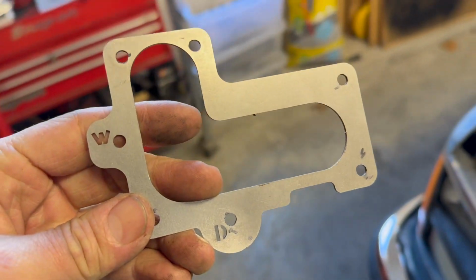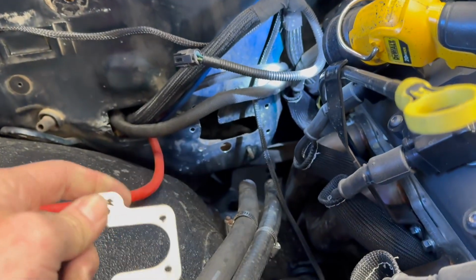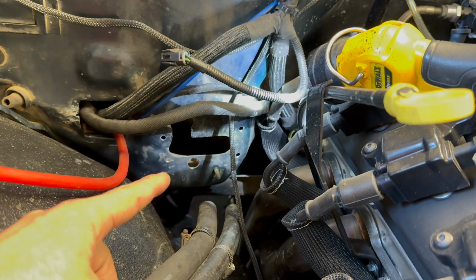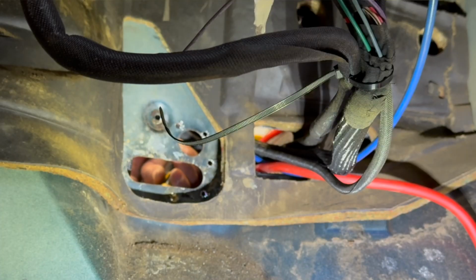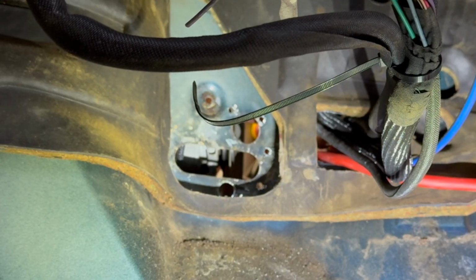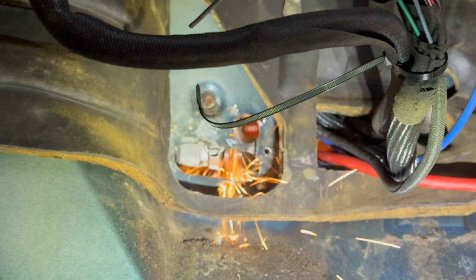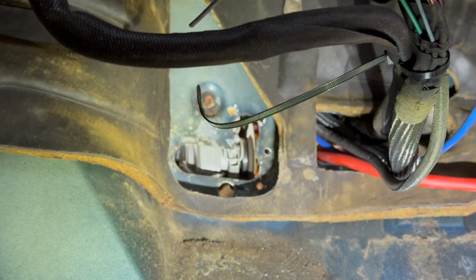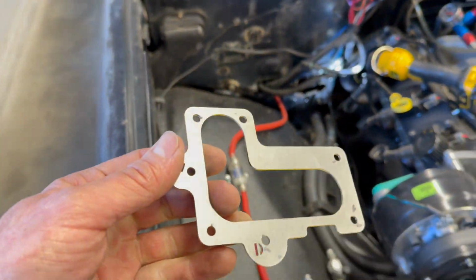This little bare metal piece that they shipped is actually a template that you lay over where the factory lines came through the firewall here, and you drill those out where the holes are marked, and then you have to drill a little larger hole in the bottom. That's for the condensation drain, and then cut, it says 3/4 of an inch of that little metal strap that's left between the upper hose and the oblong oval. So ours is cut and ready for the next evolution.